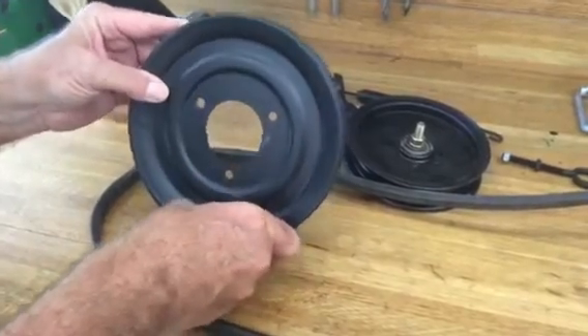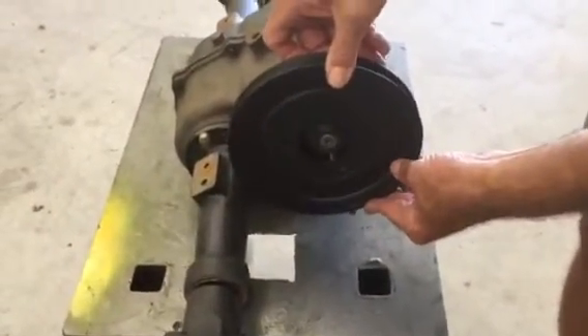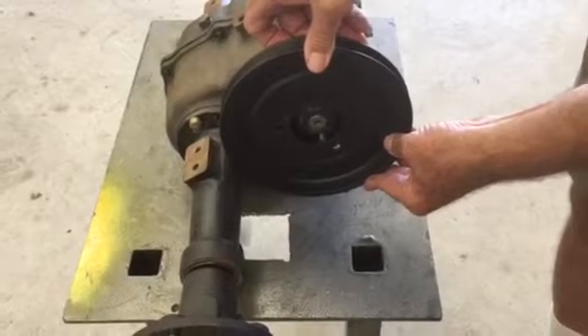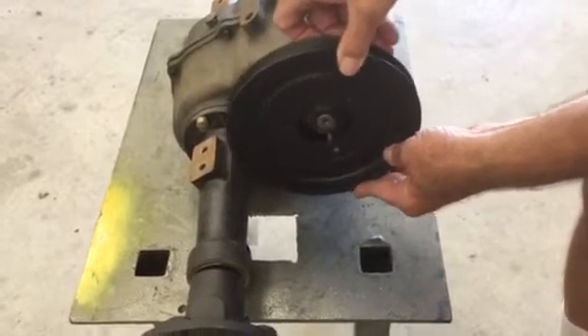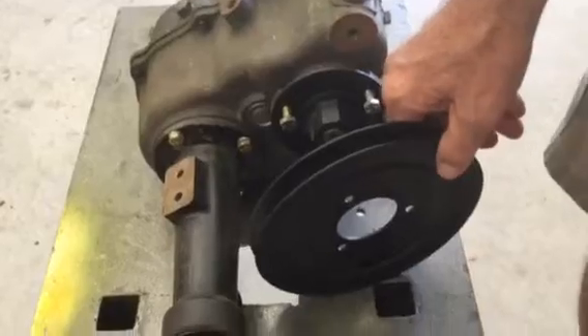To do that I'm going to move over to my prop of a Peerless 2300 transmission. This will be the right side of the tractor — you can either take the right tire off and put a jack stand under the axle, or reach under and expose each bolt, taking each one out and then taking the pulley down. Then the belt will come off easily.